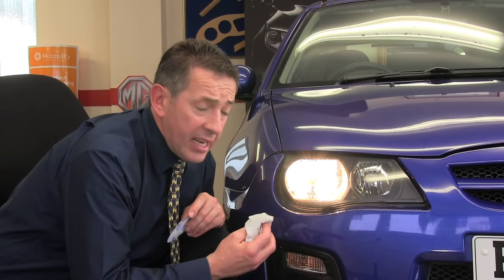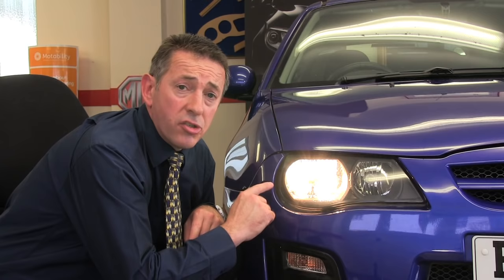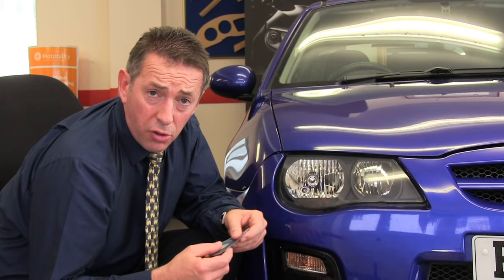As we found from the instructions, we're going to fit in the 7 o'clock position down in this bottom corner. The first thing we need to do is leave the headlamps on to warm up so the adapter will stick securely to the headlight, and just give the headlamp a quick rub to remove any dust or dirt residue. Then switch off your headlights so that you don't blind yourself as you go to apply the adapter.